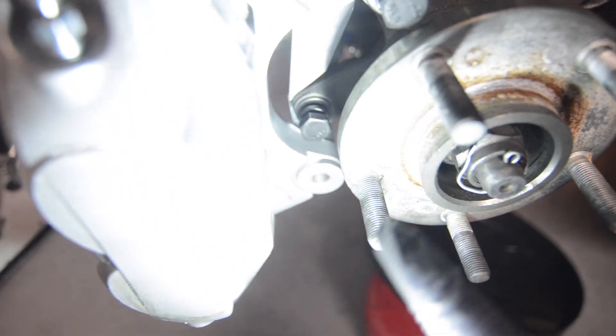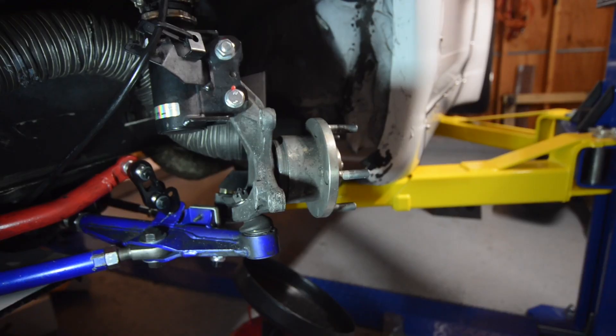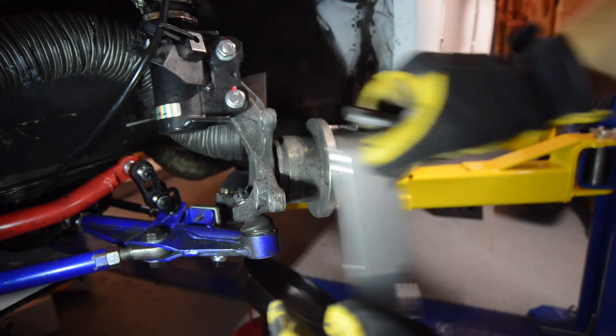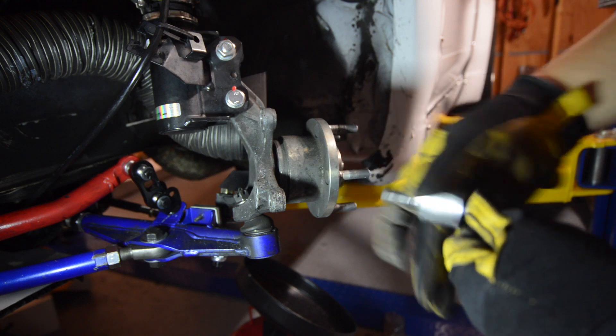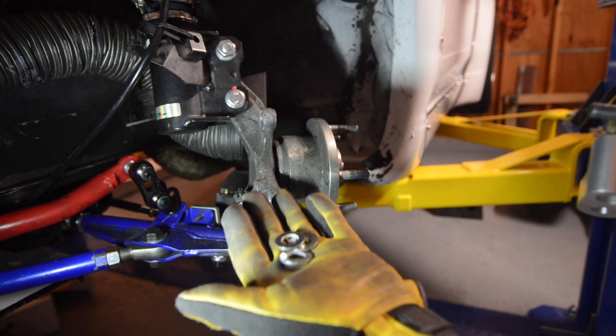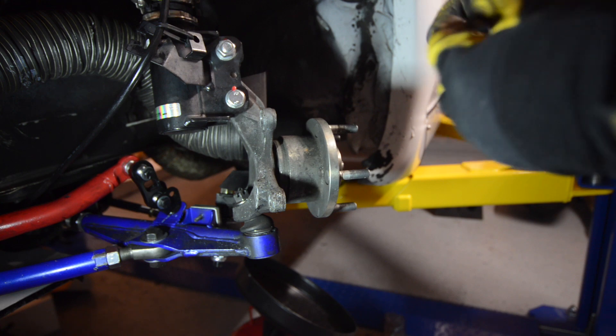On the bottom it's the bolt, wave washer, washer, knuckle, and then the adapter. With the mock up completed, we're going to install the adapter and then move on to the rotors and finally the caliper. We put the wave washer and washer on the bolt, then the big spacer, and that runs onto the knuckle. Right behind the knuckle we have these three washers and then the adapter plate.